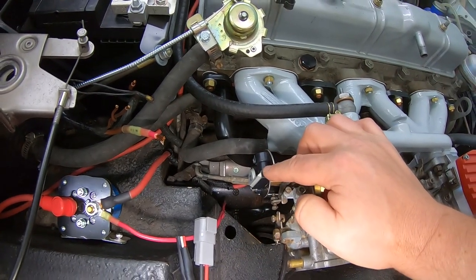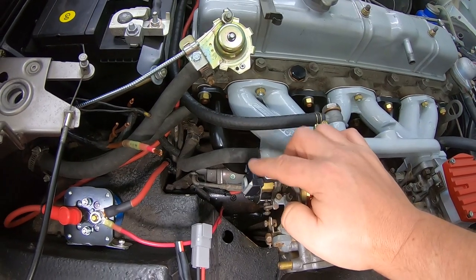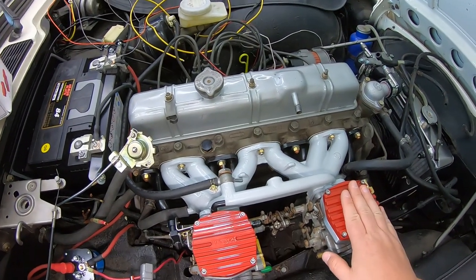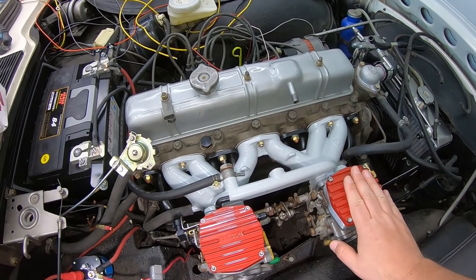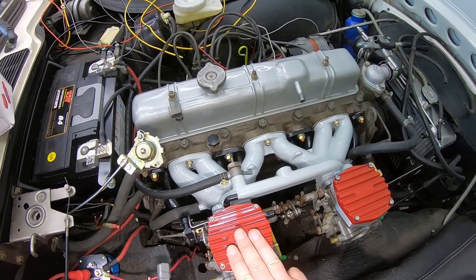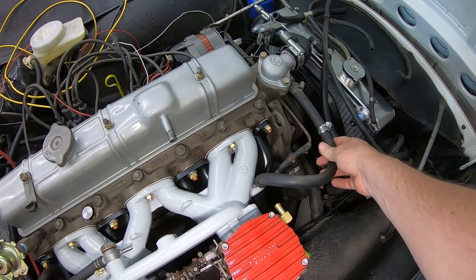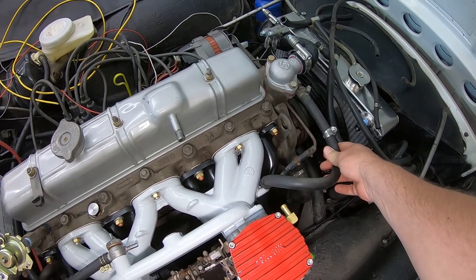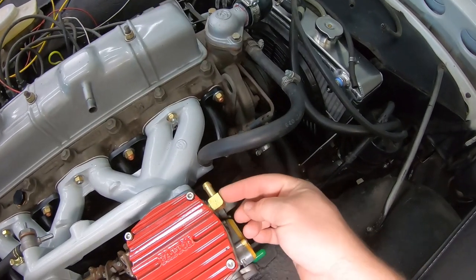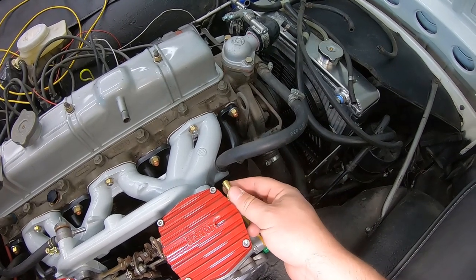You also don't want to fully lock the TPS in place until you test carefully that your linkage can move completely and freely. If you turn your TPS mechanism too far, you can break it in one direction or the other. Now that I've got all of this installed and freely moving, I've got the carburetor covers back on — these are now powder coated, normally they'd come as raw aluminum. I'm going to be moving on to figuring out how to get my coolant temperature sensor into the coolant line so that I can read coolant temperature for the ECU, and I'll begin replacing some of the included fittings with AN fittings.